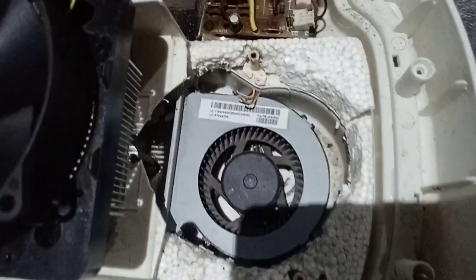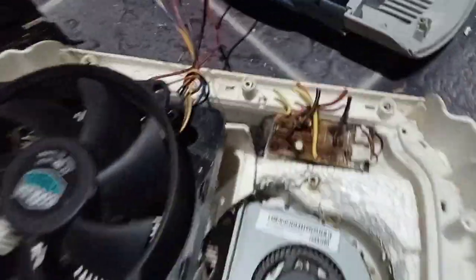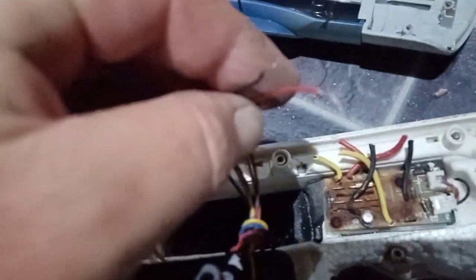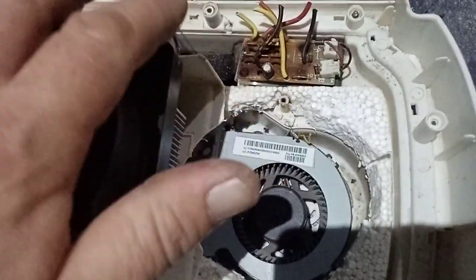After wiring, make sure you use the red wire for positive and black for negative, and cut the other wires flush. Use thin wire — the same gauge as what's already there. Don't use thicker wire; thicker wire allows more amps through, which could burn out the motor or the wiring. Thin wire keeps the amperage low.